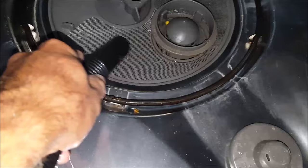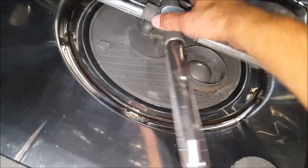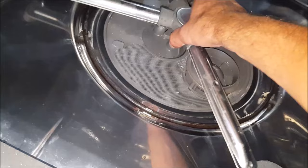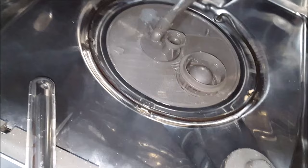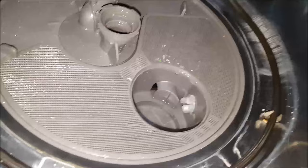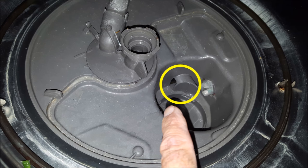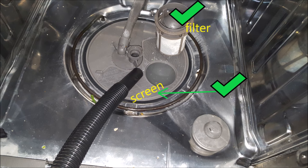In the bottom of most dishwashers there should be parts and components that look similar to this. Parts such as the spray arm should either just clip in place or twist in place, so it's usually very easy to remove them. This spray arm just has to be twisted counterclockwise to remove. This dishwasher also features a built-in drain filter that can be removed by twisting it counterclockwise as well. Once that filter is removed, the filter screen should just lift right up. Inspect all areas for possible blockage — there could be a chunk of food blocking the drain. Clean the screen and filter with a soft brush such as a toothbrush along with some dish soap and warm water.